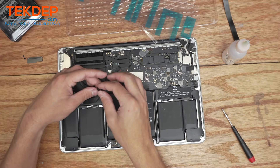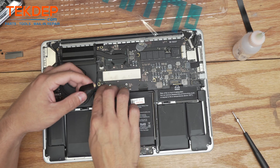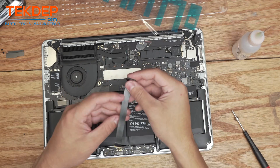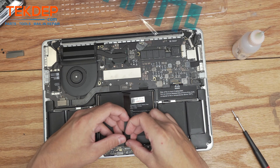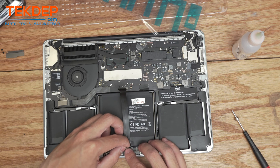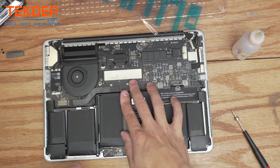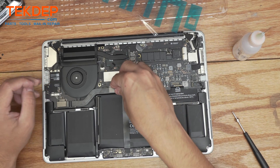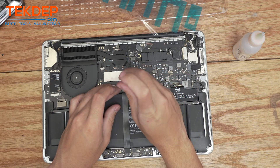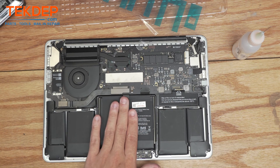The right speaker is already plugged in. Before plugging in the IO board, we need to plug in the speaker that runs underneath it — there we are. Now we'll plug in the IO board, feed the ribbon cable end of the trackpad flex into the trackpad daughter board, lower the retention bar, put the tape cover back down, connect the trackpad, then take the retention plate and two T5 screws to secure everything in place.